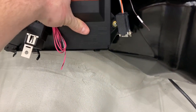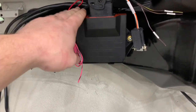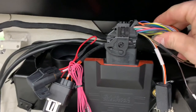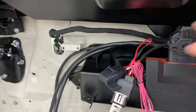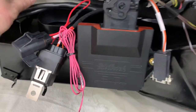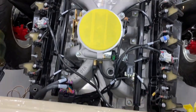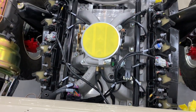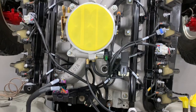This is really nice and compact, especially compared to the factory GM computer. The only thing that is a little lacking is the way they brought this in — this really should be supported all the way up with some type of strain relief, so you're not twisting and bending as you bring this around, especially because this wrap is pretty stiff. For right now, that's all the farther I'm going to get. The next video will probably be running the fuel to it and then the test run, and I hope to do that sometime in the next couple days. If you have any questions, please let me know, and thanks for watching.